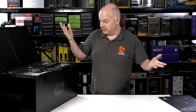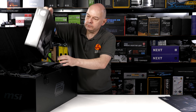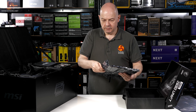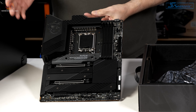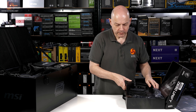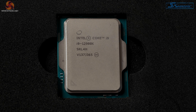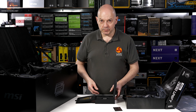After a picture of products we get to the good stuff — it's an MSI kit. We start with the MSI MEG Z690 Unify motherboard: a brief look for now, a non-RGB Z690 board with PCI Express Gen 5 and DDR5 memory support. Then we have from Intel a Core i9-12900K — the Alder Lake big boy — with 8 performance cores and 8 efficiency cores.